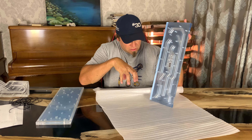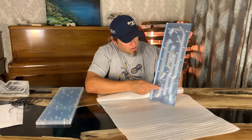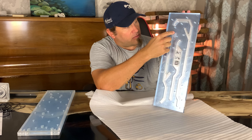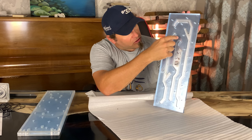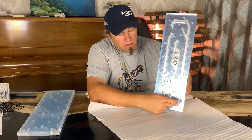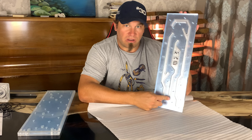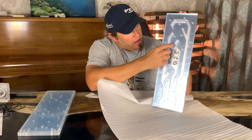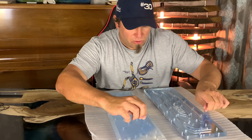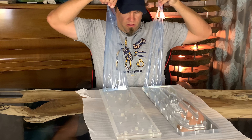The pump is going to sit over here and it's going to be pumping cold water - after the radiator - into the plate. This here is your GPU cold supply and this here is your CPU cold supply. This is our CPU return, so there's CPU cold, CPU hot return, GPU cold, GPU hot return. Those are your two hots coming down - the hotline from the components goes to the radiator. After the radiator it comes back into this little flow channel, and then out from there it goes to the pump. Those are the three channels or loops we have in the plate.